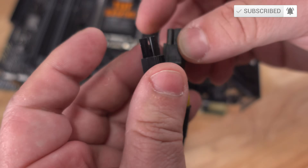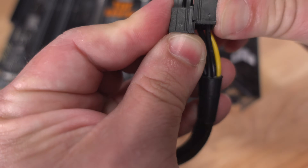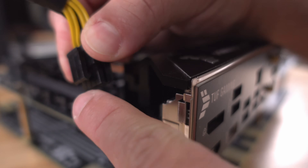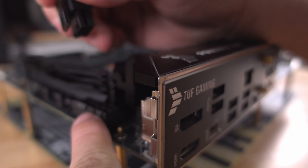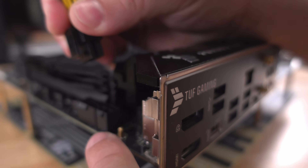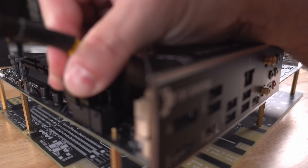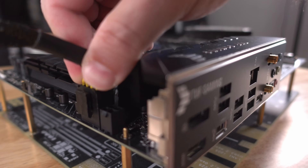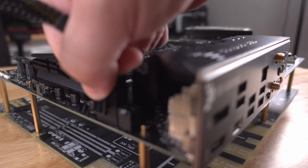The connectors are different for every power supply, but for this one you slide it together like that and it's connected. Just like the 24-pin, there's a little lever you can push with your finger that locks into the notches. Push it in and it locks in place so you can't just pull it out — to remove it, push the lever down and pull up.